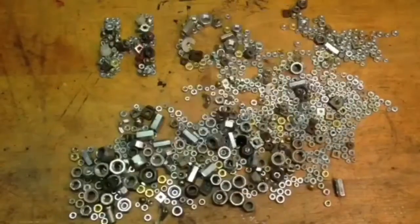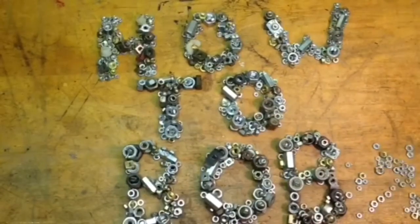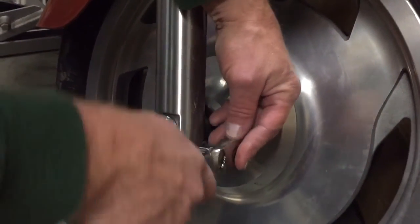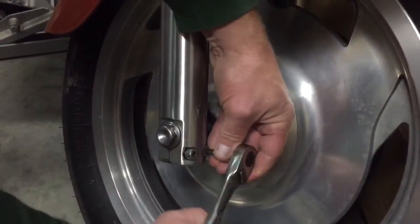Hello this is HowToBob and I made this video to show you how to remove and replace the front wheel on a 2002 Honda Shadow. First thing to note is the pinch bolts here, so I'm going to have to loosen those up. I've used an Allen socket that I happen to have — you can use an Allen key if you have one, either one will work — but I want to loosen up all four.